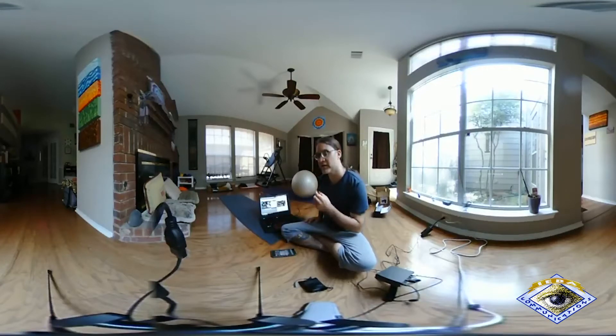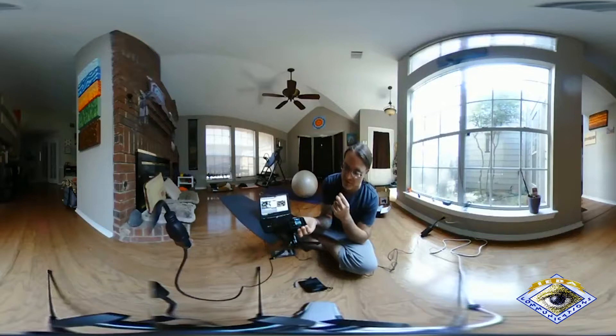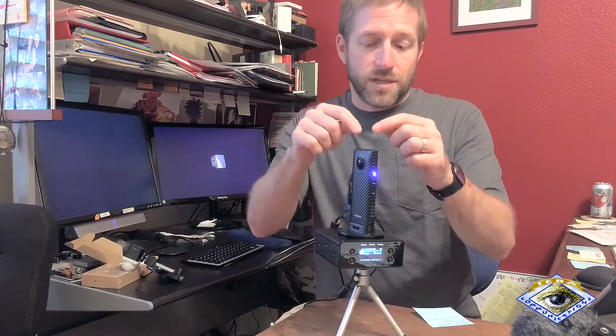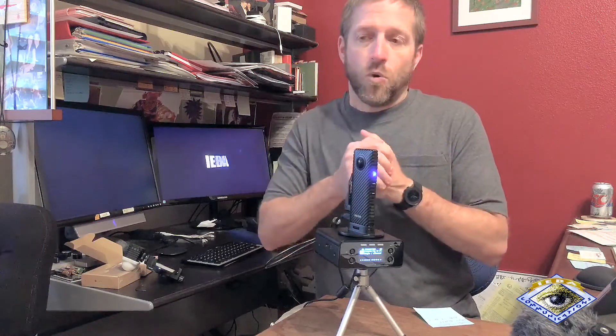I am not a 360 expert, but I work with someone who does a lot of 360 work, and I had him test this out. His experience was that the built-in mic is not very good — it's mono. It doesn't have a 360 presence to it, so you can't have sound coming from here and sound coming from there, and it's not that high fidelity. There's no microphone input on this model. The LiveShell X has an audio input, but it's not a microphone input — it's line-level. So you would need something that would go from mic level to line level, like a level adapter or a small mixer. And then if you've got this and that and a small mixer, your package is getting a little bit bigger and less portable.